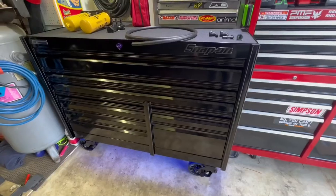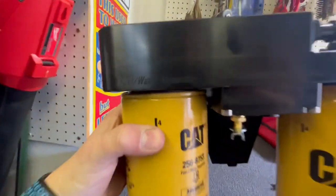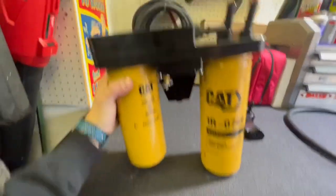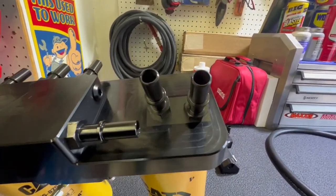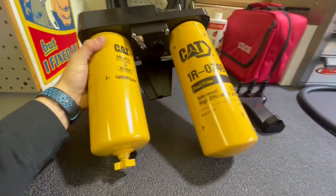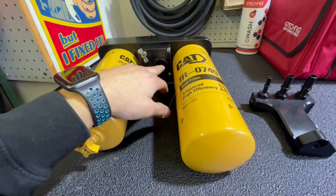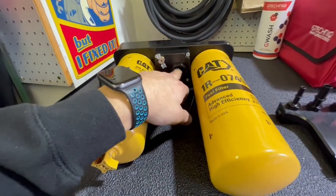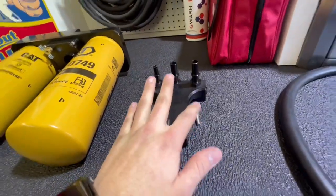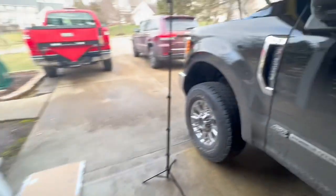Here's a better look at everything — all the labels I was telling you guys about. It's all pretty much plug-and-play. The only thing we have to do is take the WIFF sensor out of the fuel water separator filter underneath and put it back in here, reusing the OEM one. We'll show you putting this in the engine bay, cutting the hose, and putting these fittings on. We already started — first we're going to disconnect both negatives on the battery terminals, just in case.